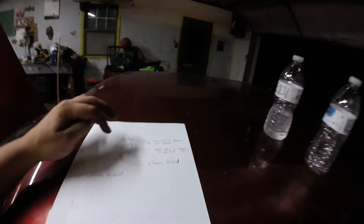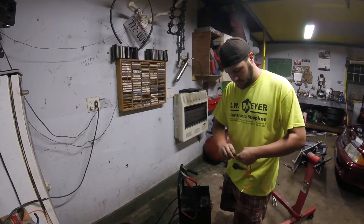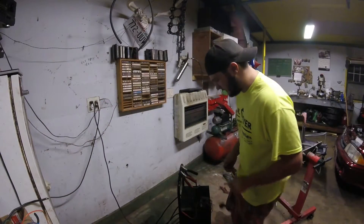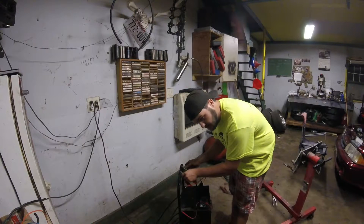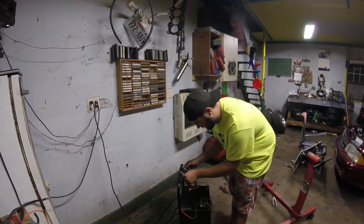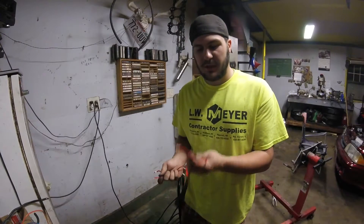If you don't know what wires should be power and ground, you can take the relay and with a bunch of bare wires, an easy way to test is to fire up a battery charger — or just use the battery in the car. Take the wires and touch them to power and ground, and just keep combining two wires together until you get the two that click the relay. So these two click on mine, meaning these two wires are power and ground, and these two are input and output.